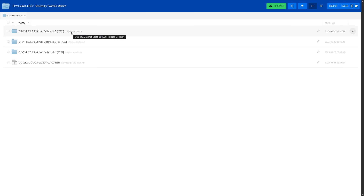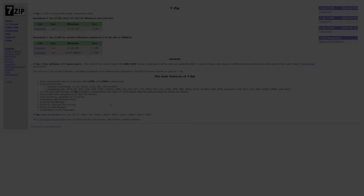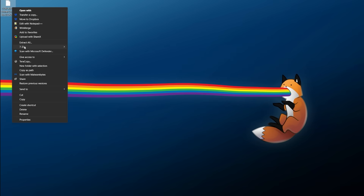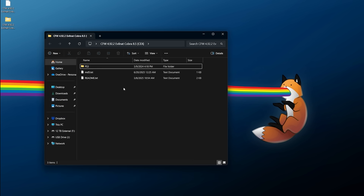For this demonstration I'm going to install the CEX version. If you just want a retail experience, CEX is fine. If you haven't converted to debug but want those features, PEX will work. If you've already converted to debug, you need DPEX. I'll also have 7-Zip linked in the description in case you need something to extract the archive. Once you have your custom firmware downloaded, right-click the archive file and use something like 7-Zip to extract it into its own folder. Inside you'll have your readme, the MD5 hash, and a PS3 folder.